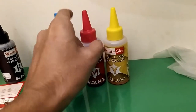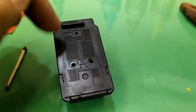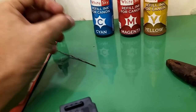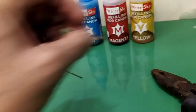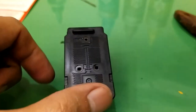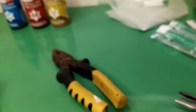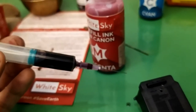Using the same method, I'm going to take 3 ml from each color and inject it into the three containers. Note that green is basically cyan, red is magenta, and yellow is yellow. I'll fill the syringe and inject it into the blocks of this cartridge, keeping track of which is left and right. I have refilled 3 ml of magenta.